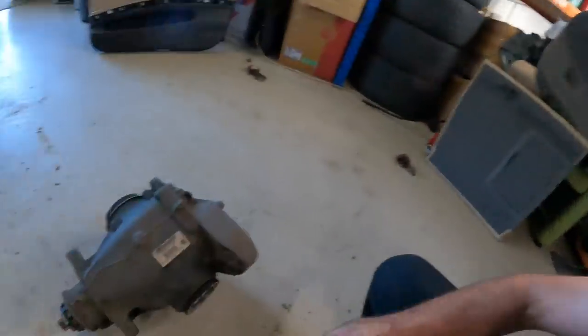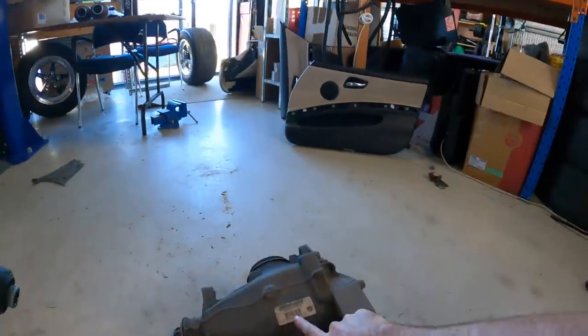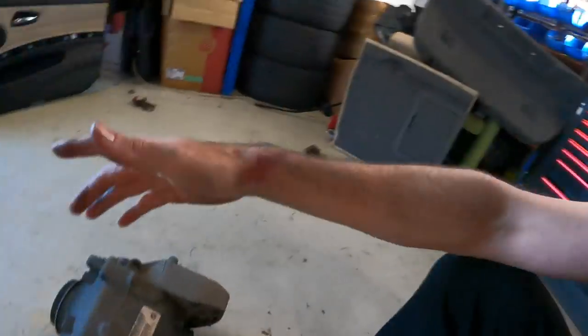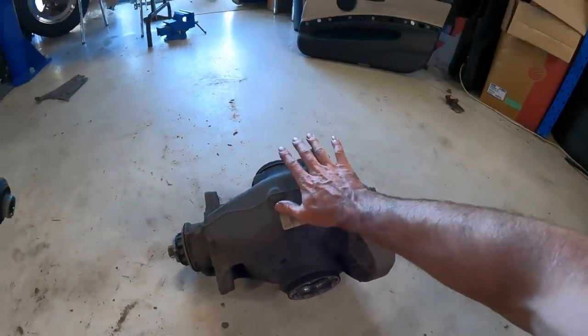You can now get around this with custom mapping in XHP, but I think it's crucial that if you're doing this swap, you get it working as standard before you start tuning anything. So make sure you get yourself a 2.56 diff ratio. You can also do it if you've got an M3 rear end — if you've done an M3 conversion with the M3 DCT ratio, you can do this swap as well and use the M3 software. But it gets a bit messy, so personally I'd recommend doing it with a 2.56 and using the normal E-Series DCT software.